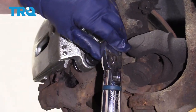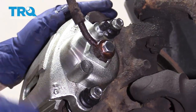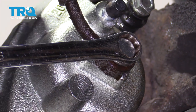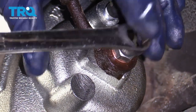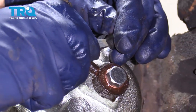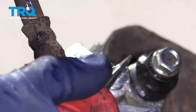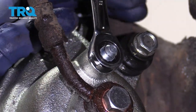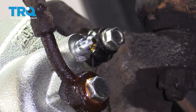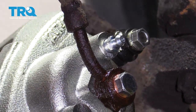Double-check. Now I'm just going to grab my 9/16 wrench and snug up the flex hose — I want to make sure those copper washers and that new banjo bolt seat properly. This is where we're going to gravity bleed it, so I'm going to take the rubber boot off. You want to protect this and put it back on — it stops dirt, road salt, and sand from getting inside and making it useless. With a 3/8 wrench, I'm just going to open this bleeder screw and gravity bleed it. I've already checked my master cylinder and topped it off. Once you've gravity bled this and you see no more air bubbles, just snug it up and put the rubber boot back on.